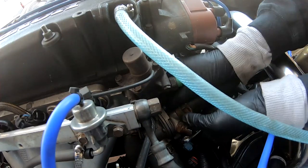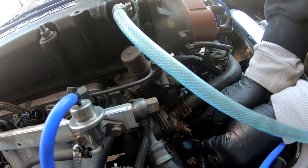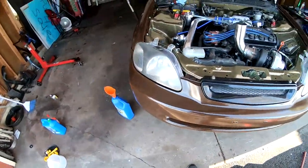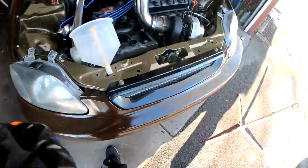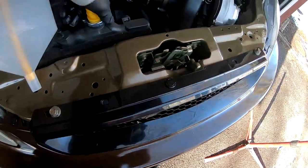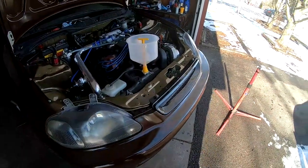I'm putting everything back together right now. I didn't use any RTV or any of that stuff because it's not required — it's not needed. That's what that gasket is for that we put in between the thermostat. Everything's back together, so I'm gonna go ahead and start adding some coolant in there. Actually, I'm gonna add this thing first and let's go ahead and use this so we can try this out. I don't know if it can be trusted or not — I'm gonna go ahead and pour a little bit of regular antifreeze in there and see if it leaks out or anything.